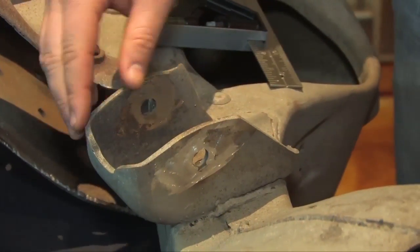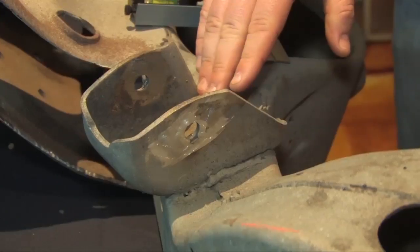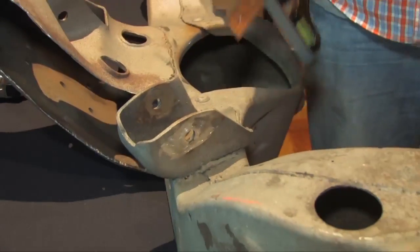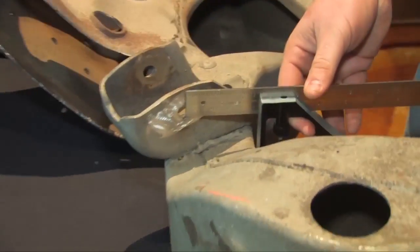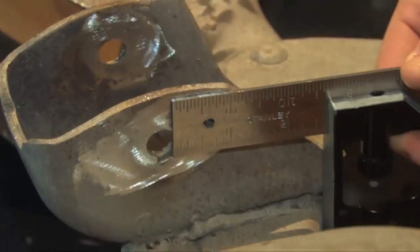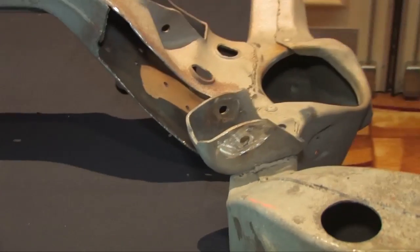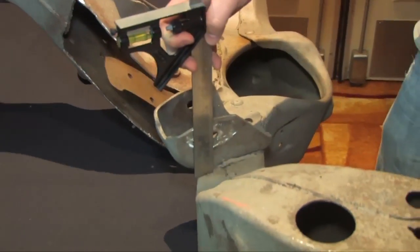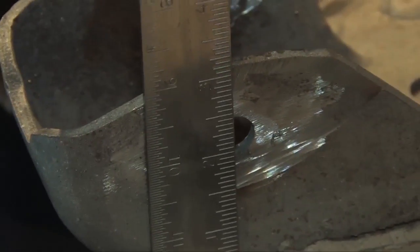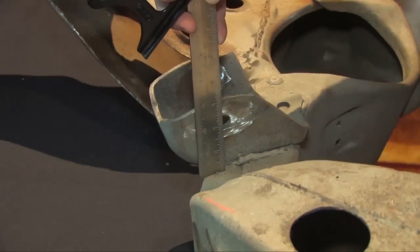K refers to the rear A frame mounts. These mounts should remain completely intact — you cannot cut the front out, you can't cut the bottom out. One whole piece; it's got to stay that way. First, we measure to the center of the hole directly alongside the mount. On the back side, that should be a minimum of two and three-quarters of an inch. Next, we measure from the frame up to the center of the hole. This should be a minimum of two inches and a maximum of two and a quarter inches from the frame to the center — only a quarter-inch of tolerance.